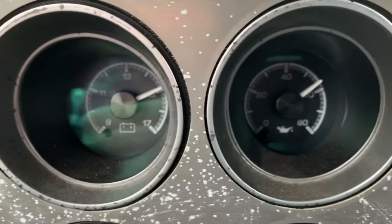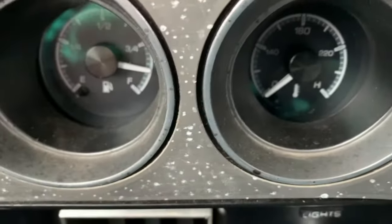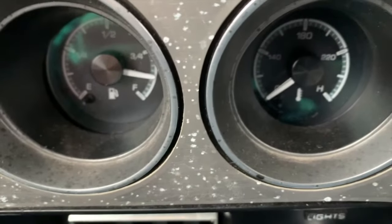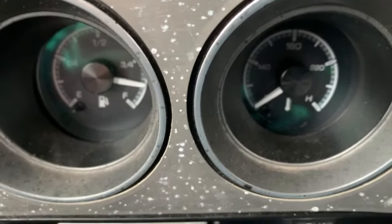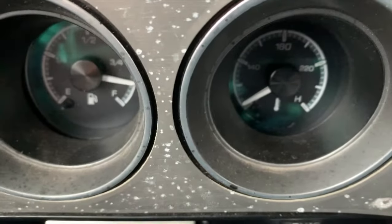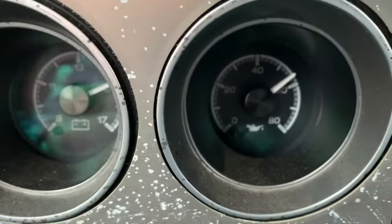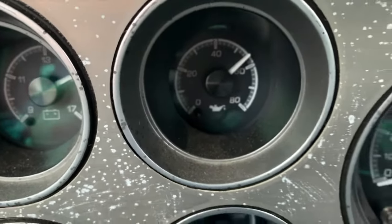But it is a 5W-40 motor oil. I did that because of cooler temperatures in the fall, winter, and spring. When we start going back to a lot of miles in the summer on this thing, it will change back to a 15W-40 motor oil from Rotella, but this is a 5W-40 full synthetic Rotella T6, which is for some reason right now really hard to find.